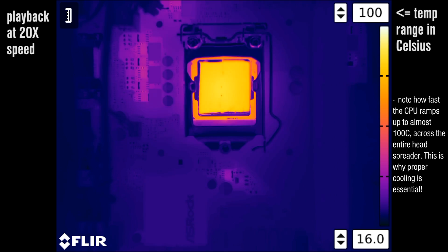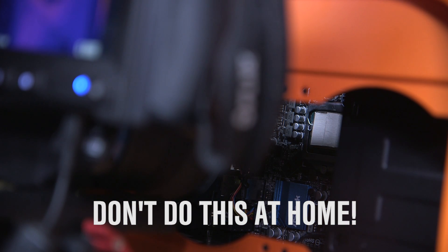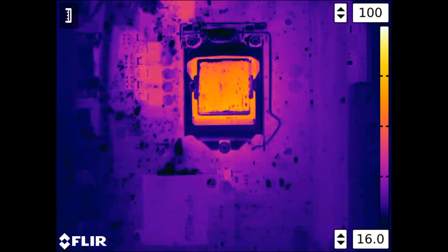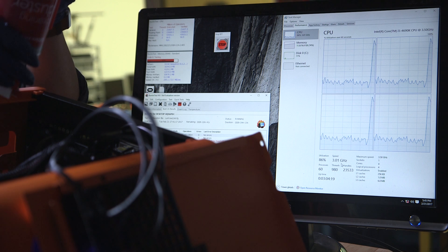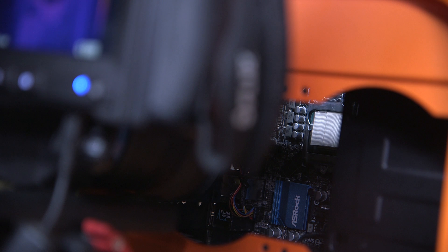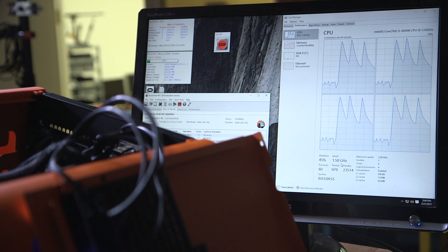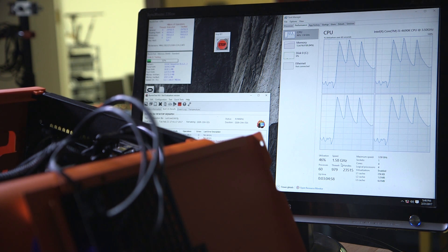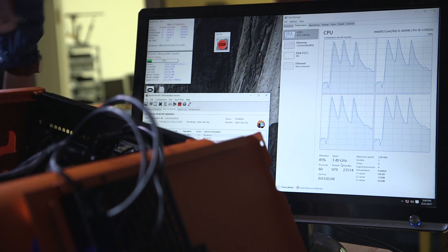So I've got the CPU running — you can tell it's hot and it's throttling. Again, we're around 0.6 to 0.9 gigahertz. I'm going to put the canned cooling on there — in three, two, one. It jumped up to like 2.8 gigahertz, immediately! Let me try again — that time it got up to like 3.4 gigahertz. So that's legit. It goes to show that the chip is really good at protecting itself, and also that any dramatic changes in temperature, it will adjust its clock speed to try to run its fastest for that temperature. That's really responsive — that's amazing!